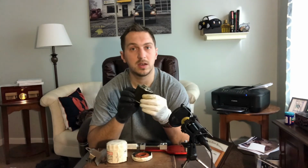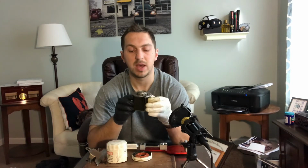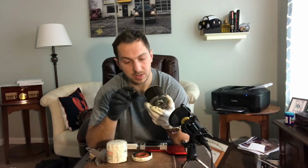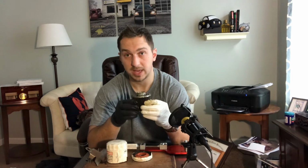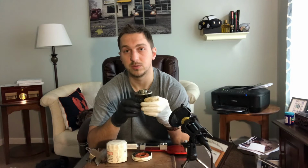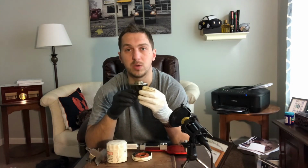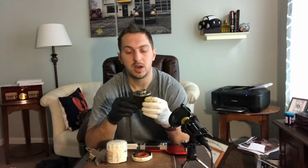Now at our stores we usually go with the basic 3,000 miles with the regular oil, and we don't really move up until they start upgrading the oil to match, and then we'll talk to them about going past that 5,000 mile mark. Now, this particular filter is in fantastic shape. Obviously, it's the OEM spec because this is the Motorcraft filter, which is what we associate with Ford. So they're not going to let something roll off the lot with an inferior product.